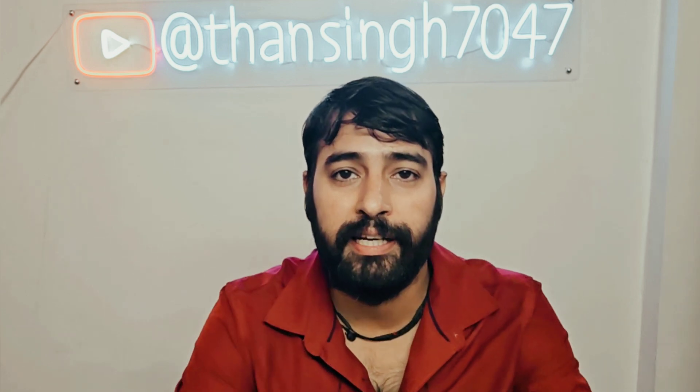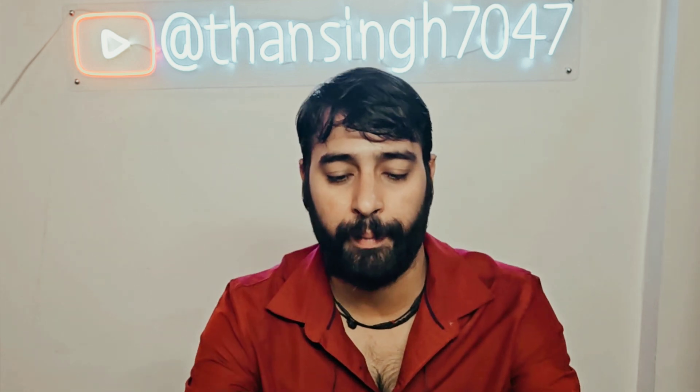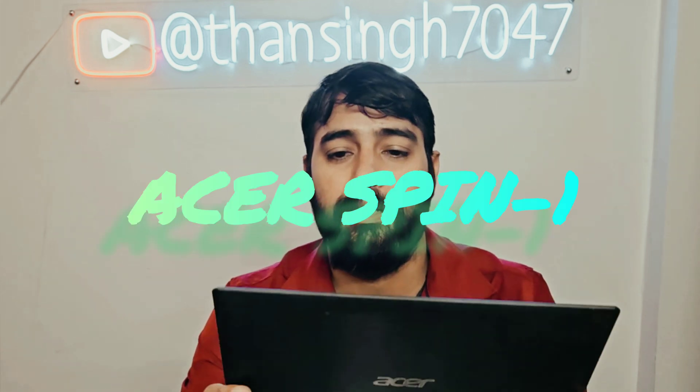Welcome back to my YouTube channel Commutech. Today is Tuesday, 29th of August 2023. We have an Acer Spin One series laptop — a 360-degree rotation laptop which can also be used as a tablet. Due to its slow performance, a user has requested a hardware upgrade, but this laptop has a fixed processor soldered on the motherboard and the memory chips are also soldered, with no extra slot for memory upgrade. The good part is that it has removable storage containing a 500 GB hard drive.